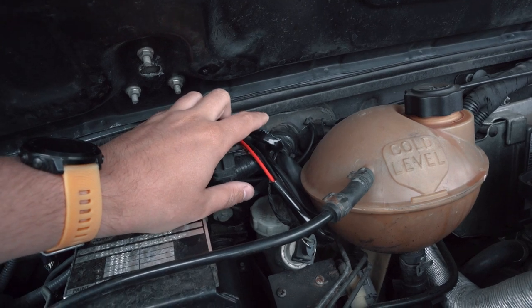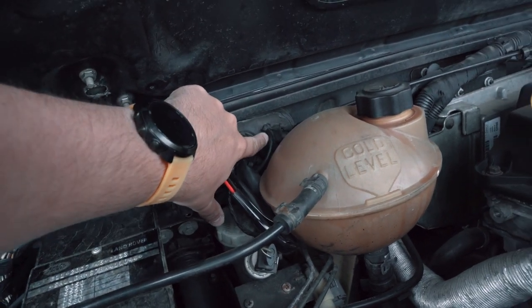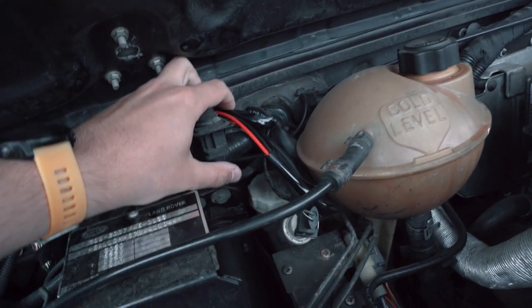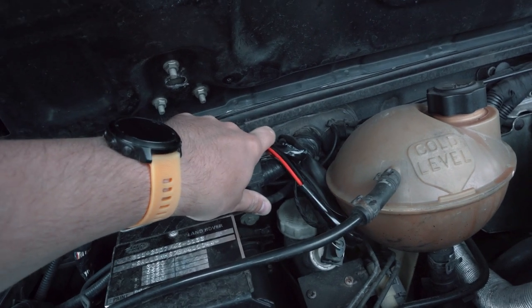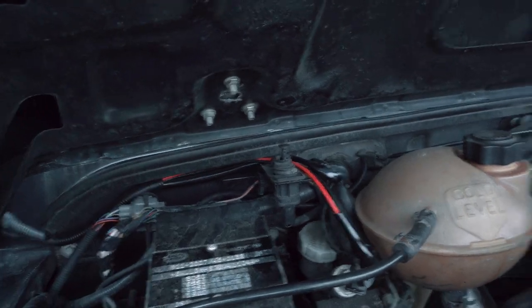I think these exist on some of the other models too, but effectively you have some blanking grommets that you can push through to install any other external accessories. So I pushed through one of those plugs and then used a metal coat hanger from the other side to pull the wires through. And what I mean by the other side, if I come round into the car,